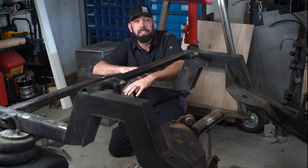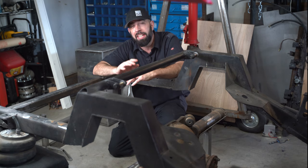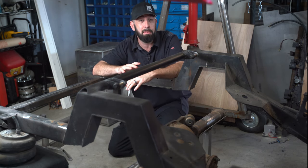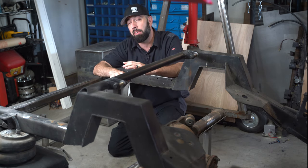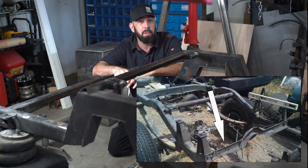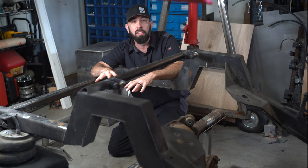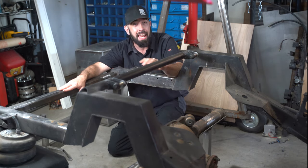Another thing the original builder did was remove cross members. That's often necessary to get a truck frame to lay flat on the pavement, so I don't have a problem with that. My problem is they didn't put any of them back. I'm not a structural engineer, but I think if Mitsubishi decided that cross members were necessary, maybe they're necessary. My rule of thumb is if you take out a support, put it back. The factory Mighty Max came with several cross members. Behind the cab alone there was one at the front bed mounts, one near the axle, and a huge one above the spare tire. The original builder removed all those and then welded in a small bar at the very back, and this entire area was open and unsupported.